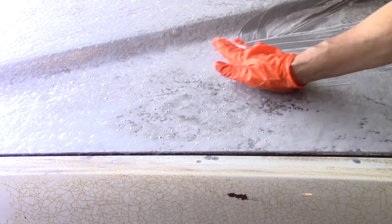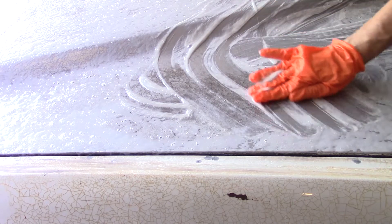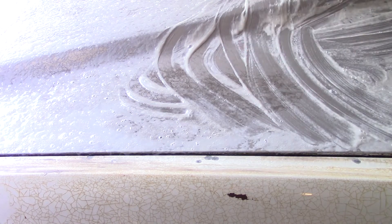I am in the process of treating my hood with Rust-Oleum rust dissolver, and it sprays out as a gel. I think I've reached the point where I wasn't going to get any more pitting or more metal cleaned up with my DA sander. After reading the instructions on my etching primer and some metal treating paint that I bought at Summit Racing, I decided this was the best way to go — treat it first and then use the etching primer. The camera is focused on the worst area, right there over the fender. Couldn't find a paintbrush though, so let's just spread this by hand.